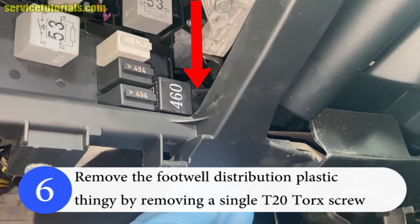We didn't have clamp pliers, so we used another tool. There is the bolt, so you need a flat blade screwdriver to loosen it. Then remove the end of the small hose using a flat blade screwdriver. It is held in two grips at the bottom and top. Then take the hose out.